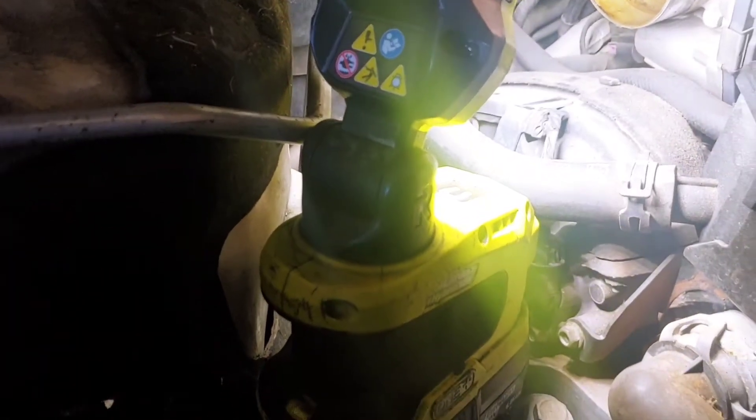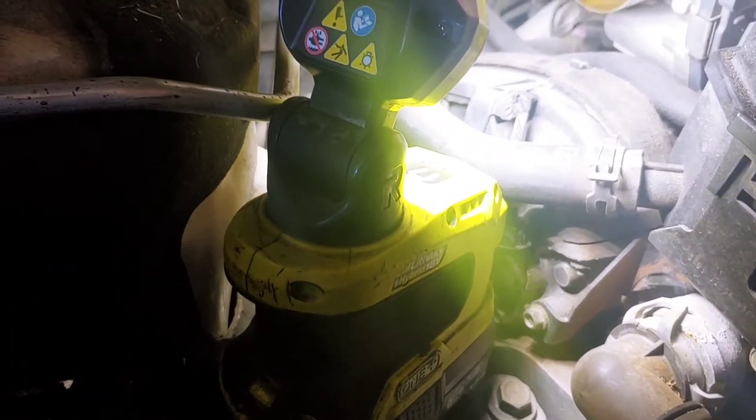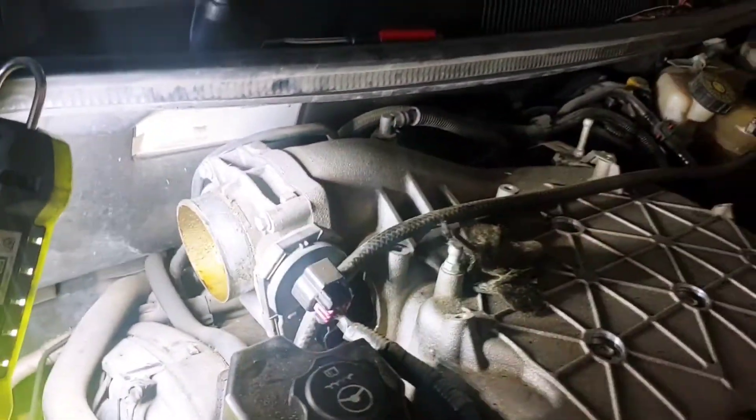These look like tens — four 10mm bolts should release that. Of course, you're not going to need to replace the gasket if you decide to do that. Alright guys, I'm glad I removed the throttle body, because if you've got these DM connectors down here behind it, that would have been impossible to get to. Basically with these, you just lift and pull and they should come out. Those are easy.